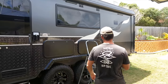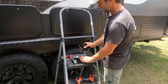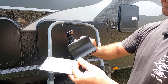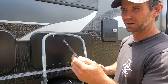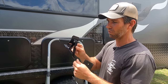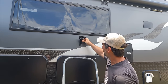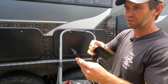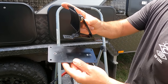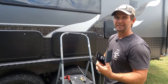Come and have a look at what you need. It's a simple install — I reckon I could do it in about five minutes. This is what comes in the box: you've got the bracket, the carrier, and a backing plate. I'm going to use the backing plate. You don't have to — if you can find a bit of aluminium or timber in your wall you can screw straight through, you can just punch some big screws straight in. What I'm going to do is Sikaflex the whole thing on, put four pop rivets in the backing plate, mark out the centre holes, drill them through the van and then put the big screws through as well because I don't want it to come off.